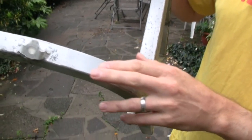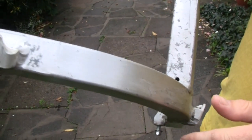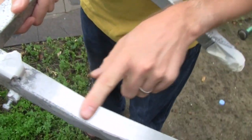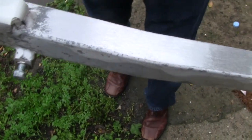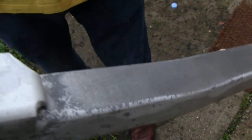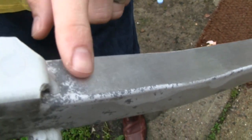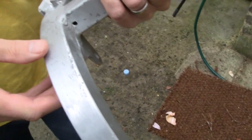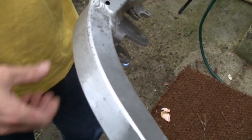I'm going to either try and bring this back to that sort of brushed aluminium finish that you can see some remnant of there, or I'm going to paint it a colour because I'm not confident I can bring it back to a finish that's worth preserving. You can see where I've applied something that's stripped off the anodising, then polished it with something called a flap wheel, which I'll show you later. I did manage to strip it back to a fairly rough surface. This other bit I tried with the anodising still on and really didn't make much progress with the flap wheel.